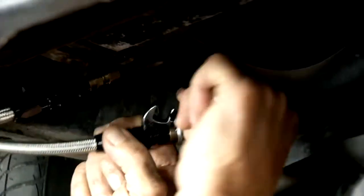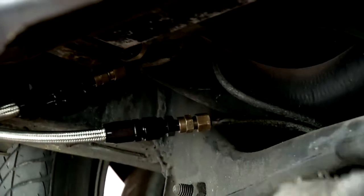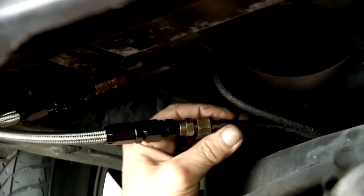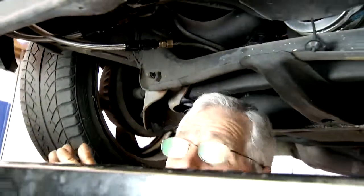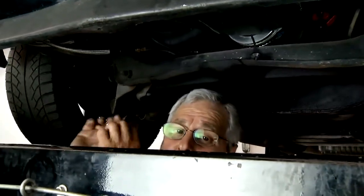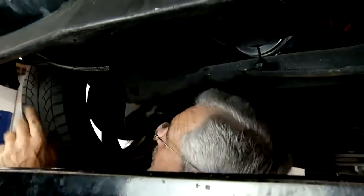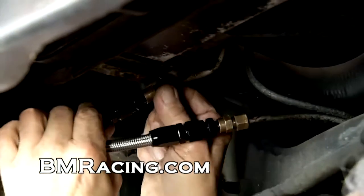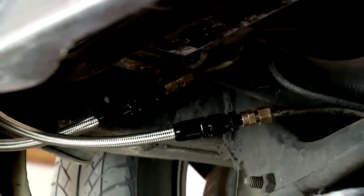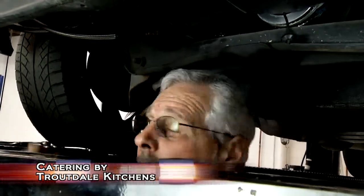All right, now, I've got our lines coming from the B&M supercooler down here, hooked up to the steel lines. These steel lines run back to the transmission. Remember, this automatic transmission came from the factory with a cooler in the radiator tank. The 2 lines went up there, went through that tank and back. We've eliminated that. We go directly to the supercooler, and that's gonna give us plenty of cooling for this transmission. Now, all these are nice and tight. We're gonna put fluid in it, fire it up, make sure you've got no leaks, check the transmission oil level, hot, idling in park or neutral.